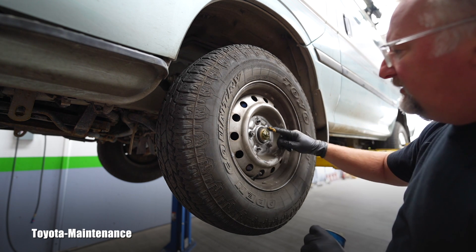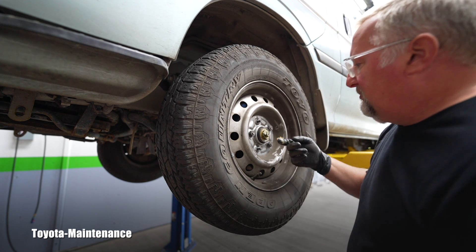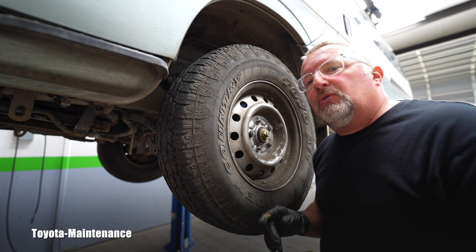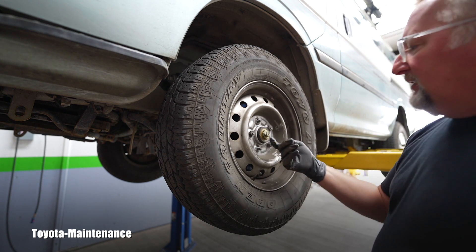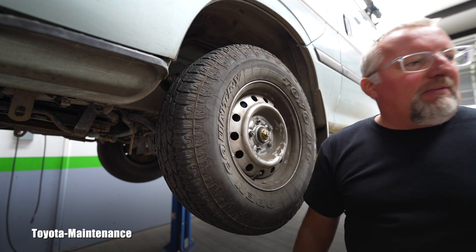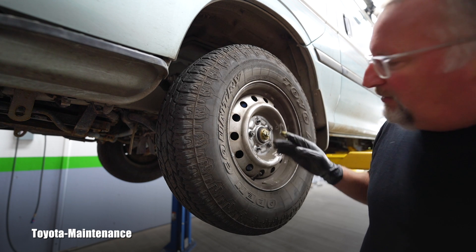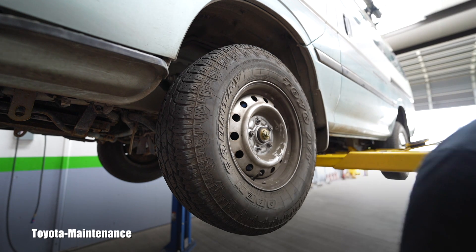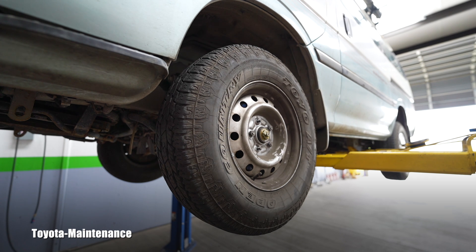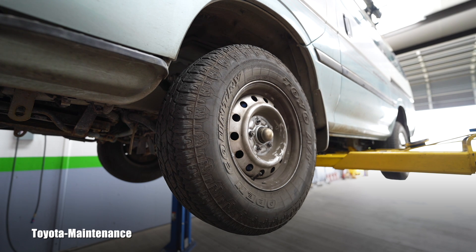Because it's such low mileage, it would not be appropriate to do a full repack if the grease was still good. If it was getting dry you would have to replace the bearing or completely repack it. But when I opened it, the grease was excellent — fully packed. Since it was super low miles, I'm not repacking it. I'll use a rubber mallet to tap the cap back on gently — there were absolutely zero signs of anybody having taken it apart previously.